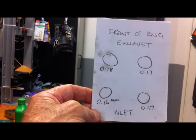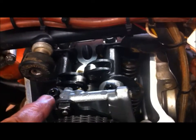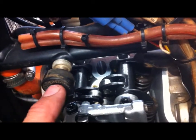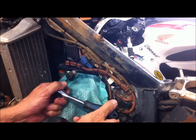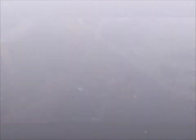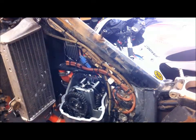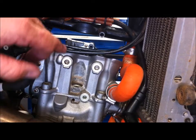I'm going to need to put new shims in. What we have to do now is remove the rockers, which is a simple job. There are four bolts to undo — a 10mm here and there, and two on the other side. I'm going to remove the tank-holding rubber on both sides so I can get access, then remove those four bolts.